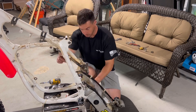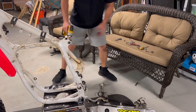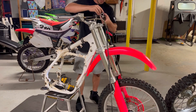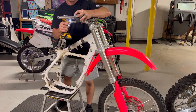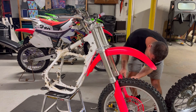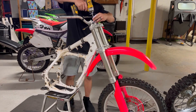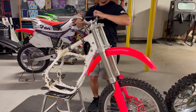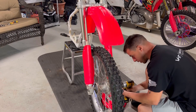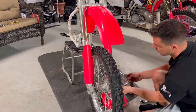The rear brake is coming off — the rear brake master is still connected to the frame so that leaves the swingarm connected. Now it's pretty much just the frame and the front end. I'm pulling the handlebars off — the forks, front wheel, front fender, all pretty easy. I'll keep the master and caliper together as an assembly — those will get blasted as one piece. Brakes work really good so no reason to take that apart. The bars are bent so I'm taking note to replace those.